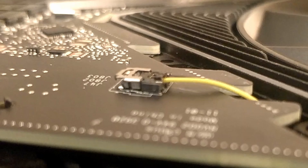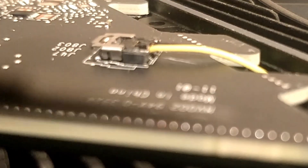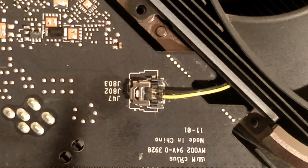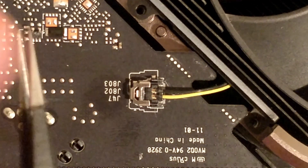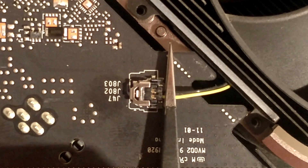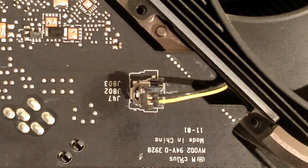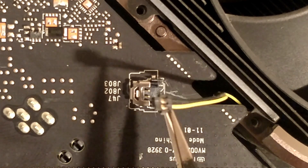You would need to put something very thin below it. Comparing it to my tweezers, you can see they are way too thick. What I did is use the wider area of the tweezers — don't use the pointy tips or you'll break the cable. Slide it slowly below the cable and without pulling hard, just gently pull up, and there it goes — unplugged, still in one piece.